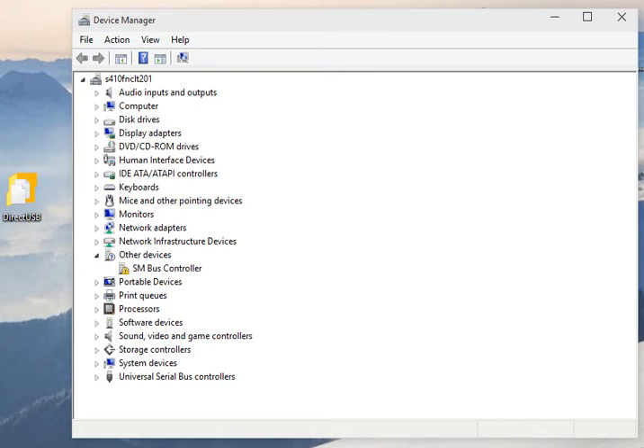There's a bit of software called DirectUSB — I'll put a link into the video so you can download it. It basically lets you recover an Ambarella A7-based dash cam. To do that you need an on-the-go cable, or OTG cable — whether that's mini or micro will depend on your dash cam and what connector it has. You can get that from eBay or Amazon, and it just connects from your PC into the camera.